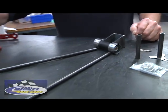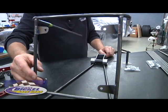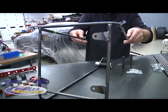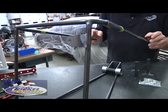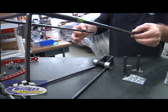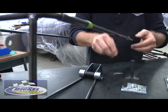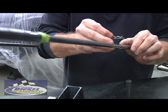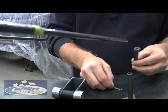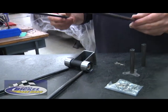The back of the parachute pack mount already has the tabs on it, and the screw hardware is provided for mounting the parachute pack plate to the back of the mount. These two tubes protrude forward, and on a tube chassis car we build, we'd have tubing off the tail section that protrudes through the rear body panel — these would slide into them. It's a male-female situation, and there'd be a couple of small hairpins to pin this in place. Two pins pulled and one cord pull point bolt removed, and this pack mount comes off the back of the car.